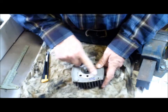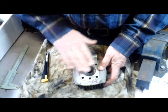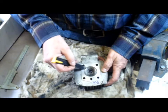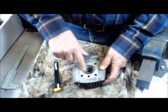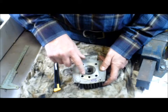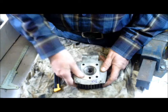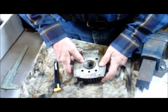If you're not going to be doing anything to the mating surface, what you want to do is get some duct tape. Put duct tape onto the mating surface — clean it well first, then put duct tape on it so it's stuck there. Then carefully cut out the area around that circle so that when you get in there and start cleaning it out, if your Dremel or whatever you're using decides to go outside the lines, it's not going to put a big score into the mating surface. So you won't be losing compression after you try to do a better-than-stock job.